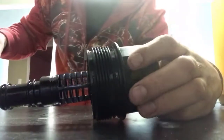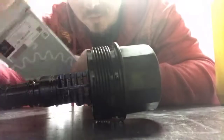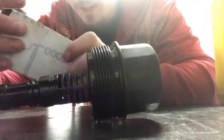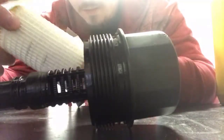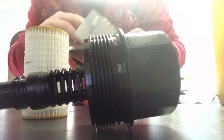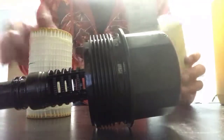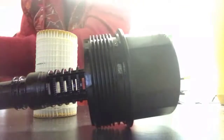So once you got those 3 O-rings I was talking about off, you want to take your filter. I specifically have a Mercedes branded filter. You can also get, I think it's MAN brand filter. They're the same ones that actually make these. These are just a fleece filter cartridge here. And I will always recommend, if you're doing the full 10,000 mile oil changes, buy fleece. Don't cheap out on a paper Chinese filter. It could hurt you in the long run.